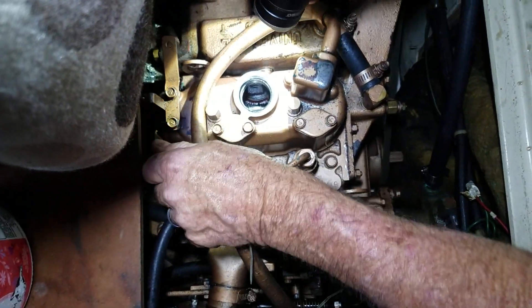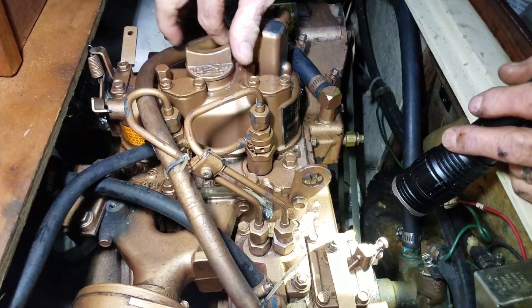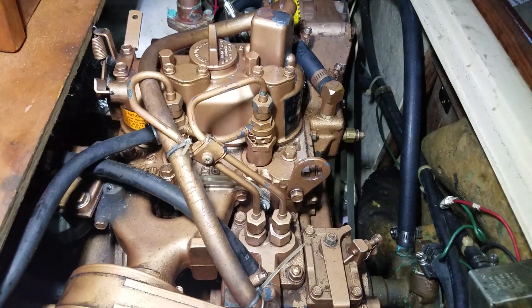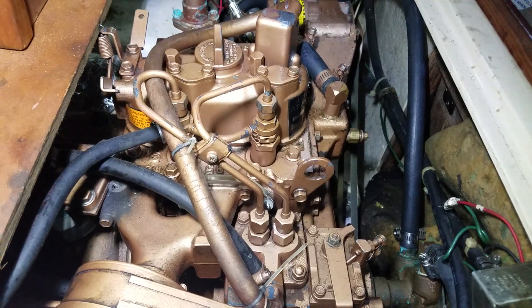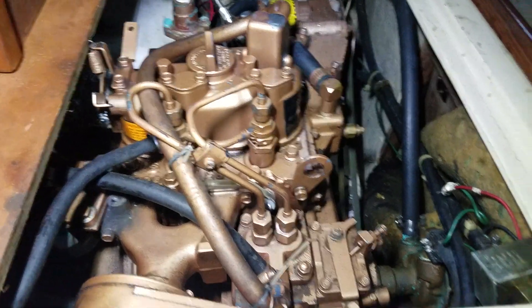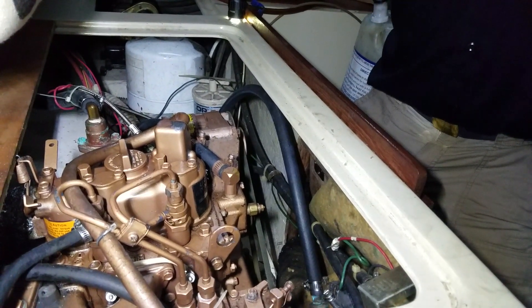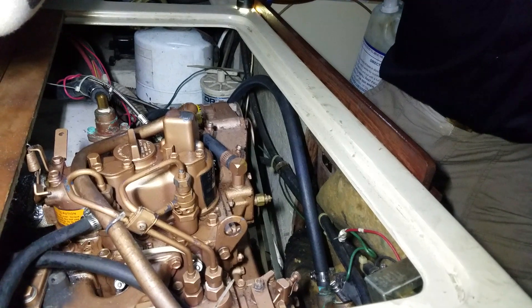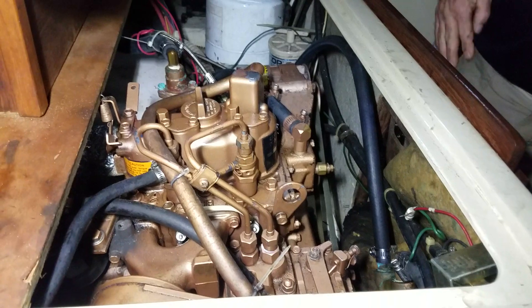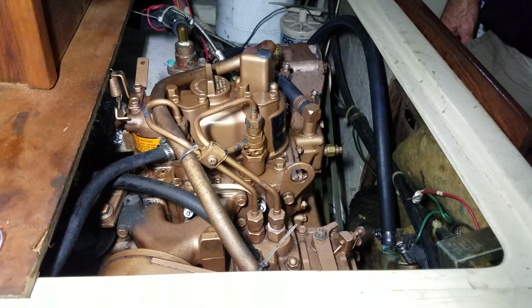The decompression lever is spring loaded — you hold it and let go. It just doesn't allow the intake valve to close all the way, so there's no compression. And without compression, it won't fire — but there is no spark. It fires strictly from the heat of compression. Because those cylinders — the stroke is only about this long — but when that piston comes up to the top, there's hardly any room left in the combustion chamber. It takes all that air and compresses it, and the temperature skyrockets up to around 1,200 degrees — enough to ignite the diesel.